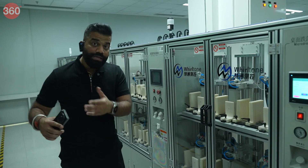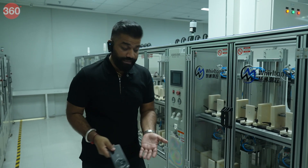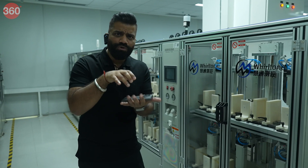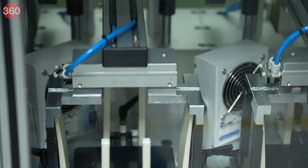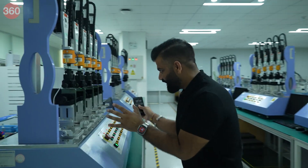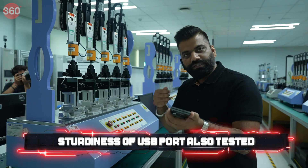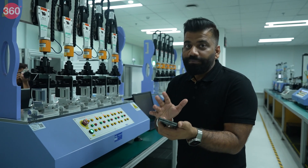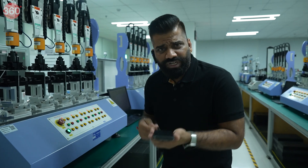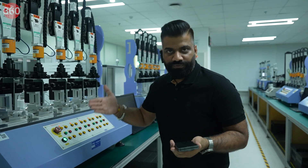Here we have a micro-drop situation. We saw the phone drop from a metre height, but this test is for normal daily life — like when you casually place your phone on a table or chair. The phone is micro-dropped onto a steel plate from a height of just 10 centimetres at multiple angles. There's also a machine working to insert a USB cable into the port with different kinds of forces, simulating real-life scenarios where you can't always be completely precise — when you're in a rush and just want to plug in. This ensures the USB port stays intact throughout the lifespan of the phone.